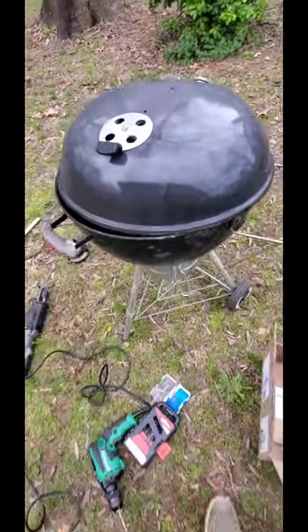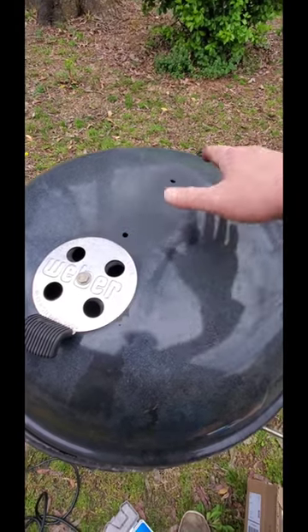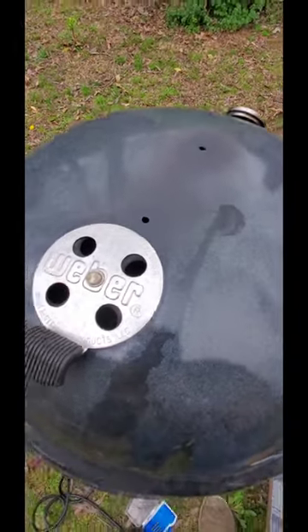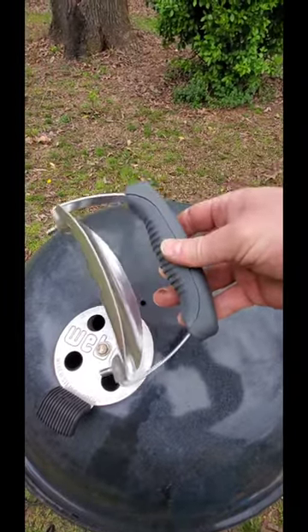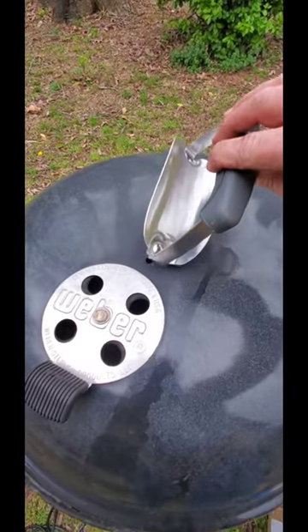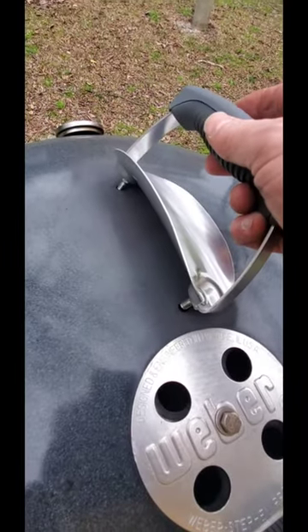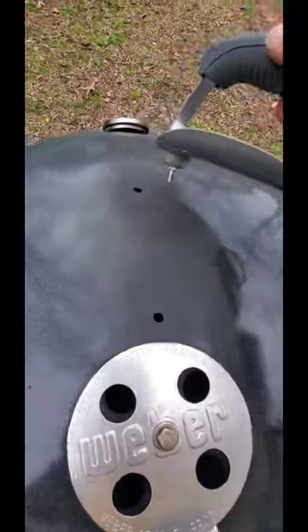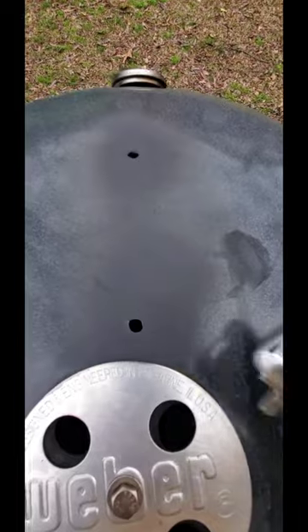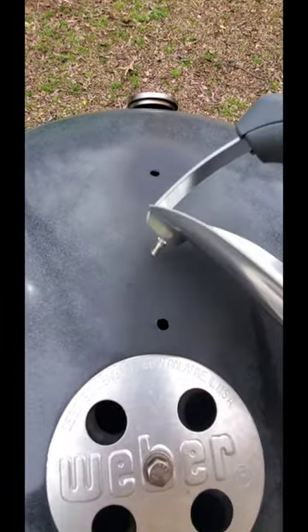Next, I took the handle off this one. I used an angle grinder with a cutting wheel and went in there and cut that old handle off because it's tack welded on. Then I took my new handle that I ordered with the heat shield and just lined it up, drilled the first hole, then marked where the next hole was gonna go and drilled it second — making sure it fit right. Then I went back with some high heat paint and painted over where I'd ground it down. Cut it off as close as I could and smoothed it out with a grinder.